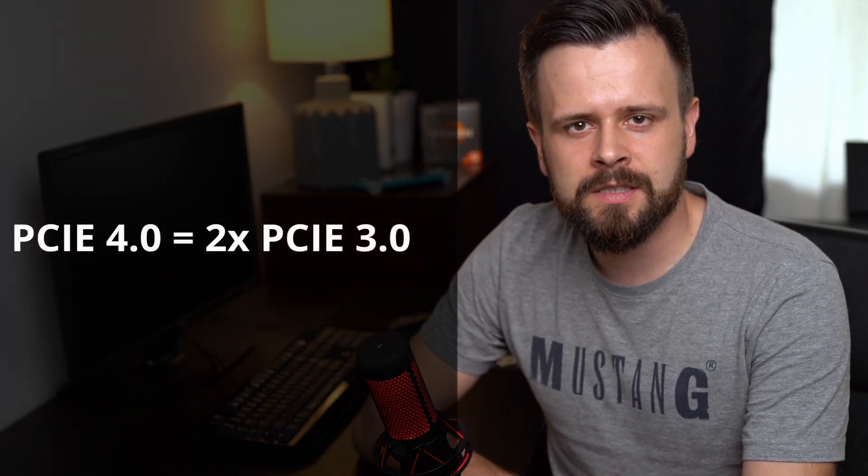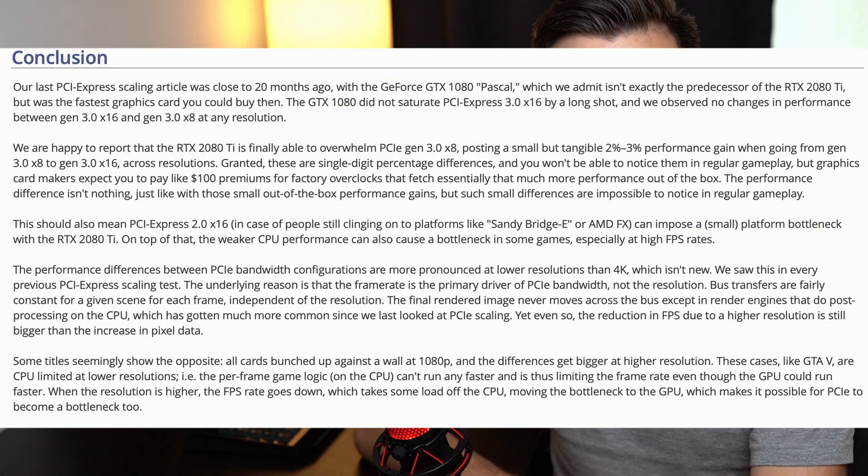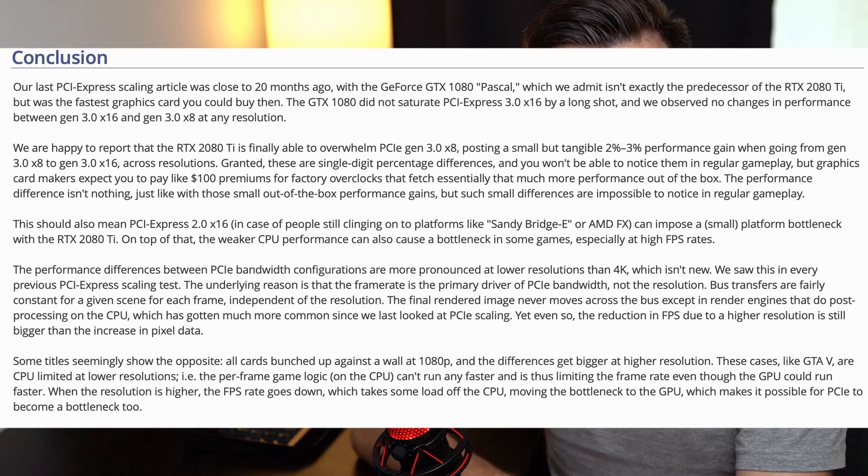What's the main difference between PCIe 4.0 and 3.0? It's mainly about speed. PCIe 4.0 offers up to 64 gigabytes per second of transfer speed using 16 lanes — as much as a typical graphics card uses. But do graphics cards really require that 64 GB/s? The short answer is no. The 2080 Ti, one of the most powerful cards in the previous generation, was only able to saturate PCIe 3.0 with 8 lanes, which is half the speed of what PCIe 3.0 with 16 lanes offers.